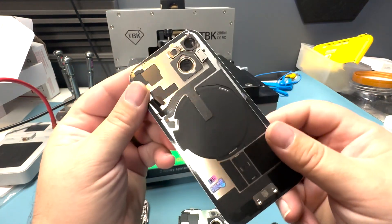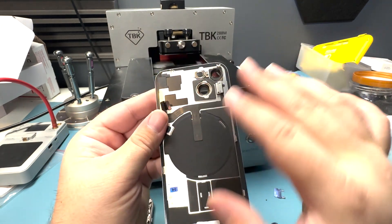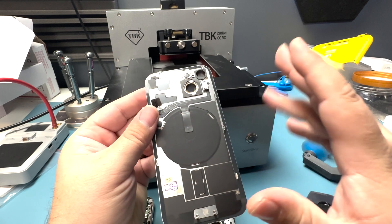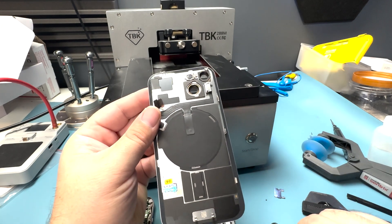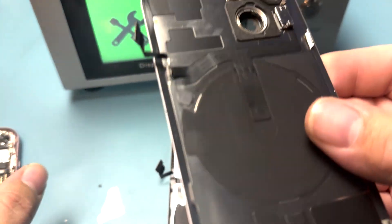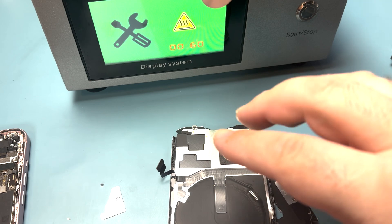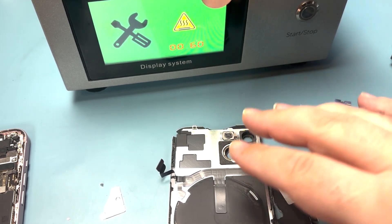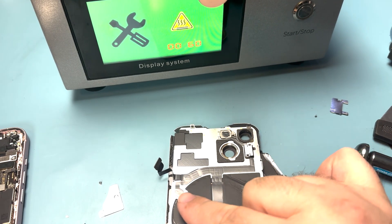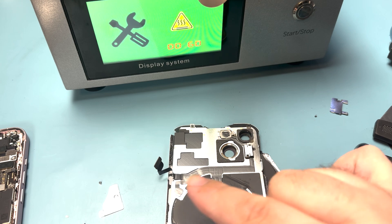As long as they are original, there is no need to worry about the IC. This is an original pull — it's got all the brackets and screws, everything's ready to go, minus the adhesive. Let's connect this up to the phone and see if it gives us any notifications or issues. In the settings, it has no notifications, and the reason for that is because this is an original IC. It doesn't have to be the exact one that was paired. If you're obviously getting an aftermarket one, you will want to transfer over the flash flex, and you won't want to mess with the IC. It's possible to move over, but it's even less practical than the iPhone 14 and 14 Plus.